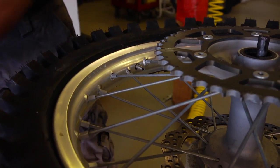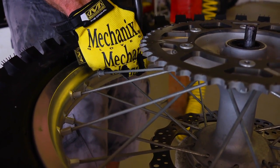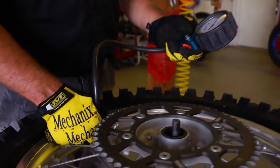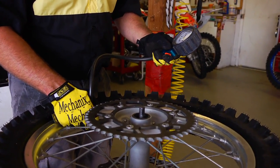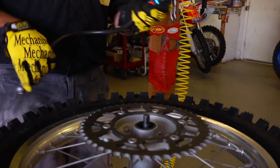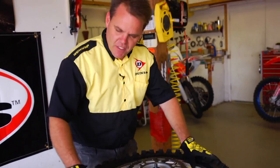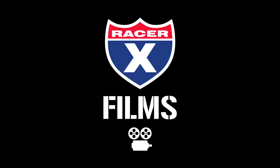Then you come over to the valve stem, pull the nut off, and put that rubber piece back on that Honda gave us. We're going to check the pressure — most outdoor use is 12 to 14 pounds pressure. I'm going to set this one right at 14; probably not going to ride for a couple of days. Put our cap back on. So now that we're all done, this wheel is ready to hit the track. Hopefully we'll see you out there soon.